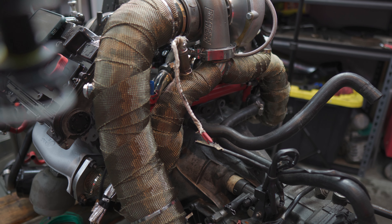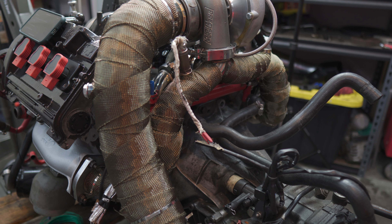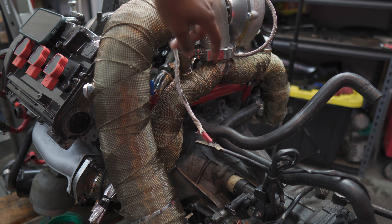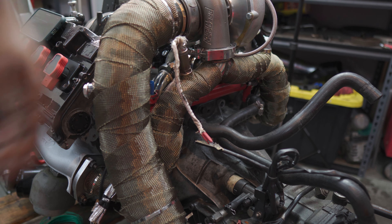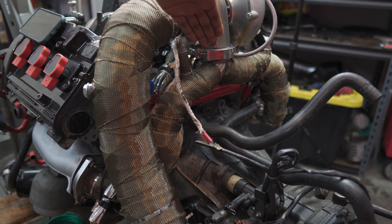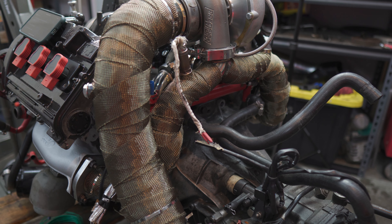Next part of the essentials is the Excess Power single turbo kit. Without the single turbo kit, there's no going single turbo. The turbo kit bolts directly onto the 2.8 manifolds for each side of the uppipe. You'll see the Y here, where they V-band onto the turbo. These are only available with precision V-band flanges, so if you needed to use a T3 or T4, you'd have to either modify or use an adapter to go from the V-band up to the T4, which can be a bit of a pain. But there are a lot of great precision turbos out there, so definitely not a bad place to start.